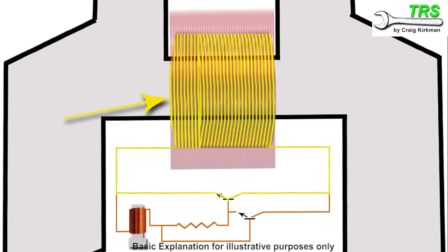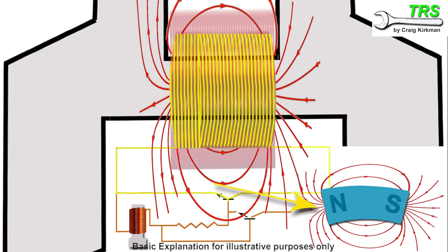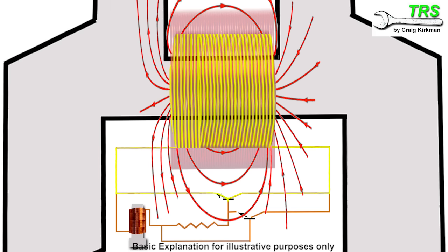If a copper coiled wire surrounding an iron core has an electrical current passed through it, that itself becomes a magnet — an electromagnet. So this primary coil takes on a magnetic field of its own, very much like the fixed magnet. This electromagnetic field of the primary coil is large enough to be felt by the whole of the secondary coil. All of this electron flow is happening whilst the fixed magnet on the flywheel is passing over the trigger coil pack. The magnet has to pass over it fast — it can't simply stand over it static.